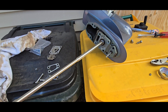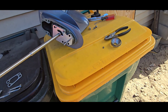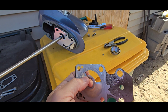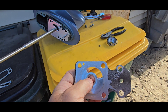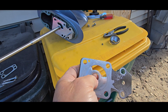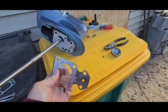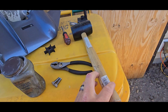Pay attention to how this plate came off — there is a right and a wrong way to put it on, it's not universal. You'll see a half-moon or quarter-moon shaped opening; the little tabs on either end should be facing down towards the propeller. When you put the new one on, make sure you don't put it on backwards.